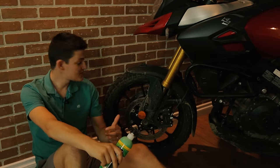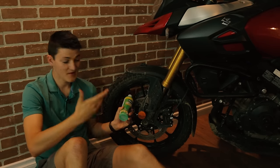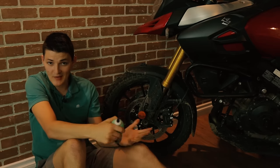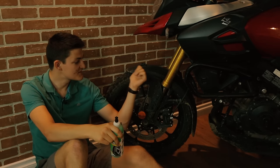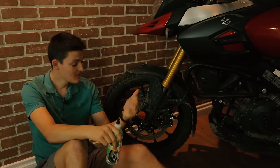My number two mod to improve safety is green, gooey, and cheap as hell — tire sealant. The idea is simple: I deflate my tire, pull the valve out, and squeeze this stuff in. Then I just pump it back up and forget about it. As I ride, centrifugal force will spread the slime all over the inside surface of my tire, and if I run over a nail, then this will magically plug the hole. Okay, so maybe it's not magic, but it is clever.